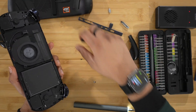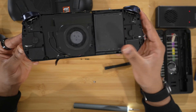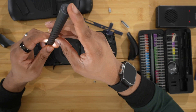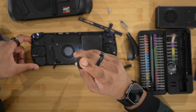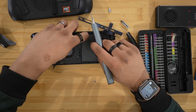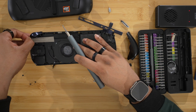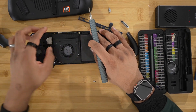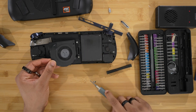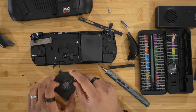Now it's open. We're almost to the SSD, but we have another layer to go. Under the fan here — you can see a pretty large fan — and there's the battery. We have to get under this fan plate to reach the SSD. First, take off the fan: there are three screws for it. Once those are off, carefully peel up this thermal tape — you definitely want to keep this tape, so don't let it curl or get damaged. Take the fan out, unclip it from the little clip, and set it to the side. You don't have to unplug the fan, just set it aside.